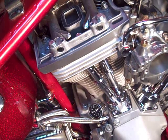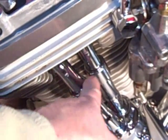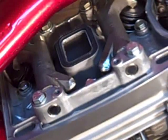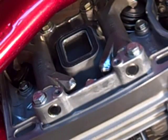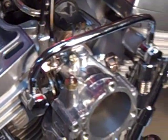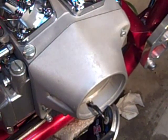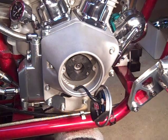No sense watching me struggle with the push rod covers. Basically all I did was use a screwdriver to get that down, and then pop that in. The head is put back together and torqued down. I'm going to put the head gaskets back on, and then I'm going to put the ignition back together — put the rotor in and then the module.